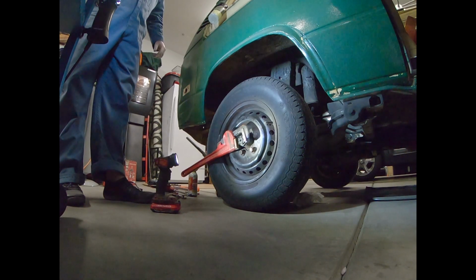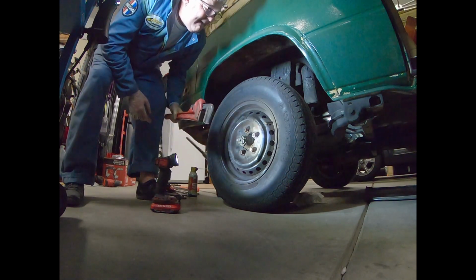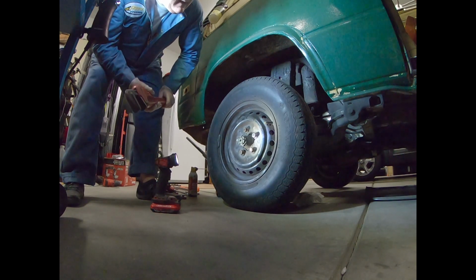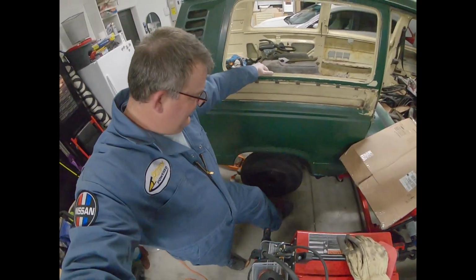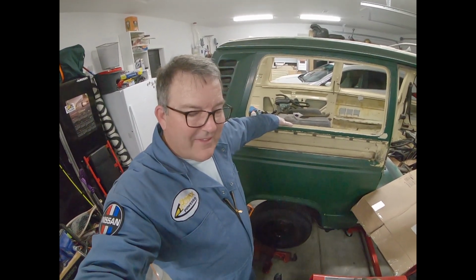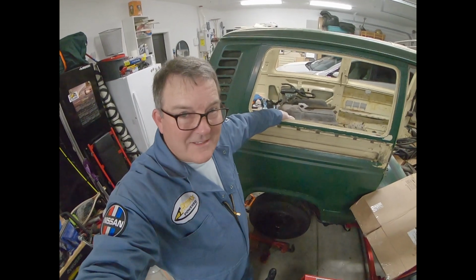This is where I think I saw that I shouldn't have taken the axle out of there, because well, we might have ourselves a predicament. Okay. And then there was one. So what we've ended up with here is I've got to take this off so I can get to the stub axle, so I can get the one bolt that's still attached on the stub axle side of the CV joint.